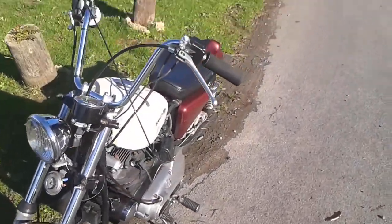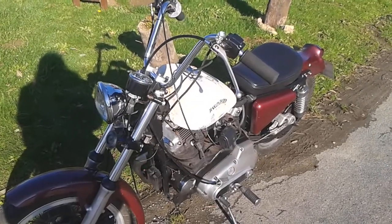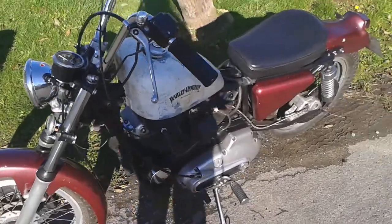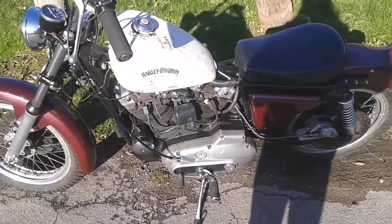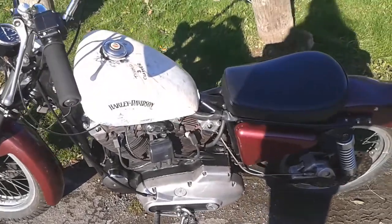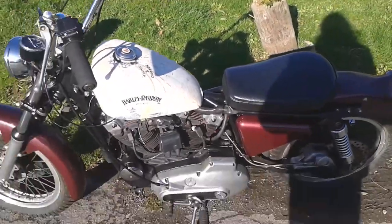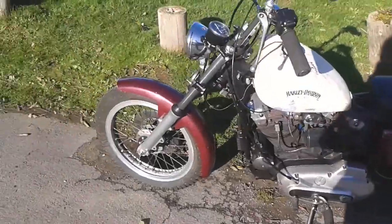But you can't do a lot about this. My BSA was the same — well, both BSAs were the same. Every horizontally split crankcase I've ever had — CD175, GS550, SR500, CB200 — doesn't matter, they're all fairly oil tight, because they're a pan holding oil. They're not two pans squished together trying to stop oil falling out the bottom. So that's it — I've got four faults with the XLH Ironhead. Other than that, if you like old bikes it's pretty damn good.